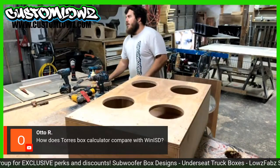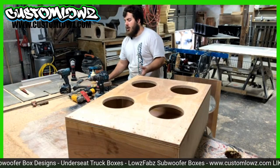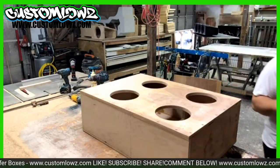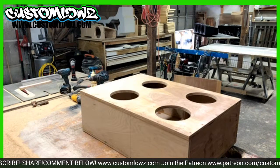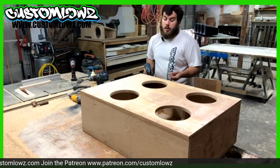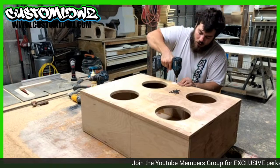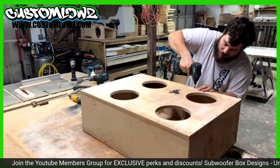So the difference really is that WinISD is going to be a more complex version. You probably get better, well, I don't even want to say better results. I don't use WinISD personally. I use Torres Box Tuner to get my basic box volume and tuning, and then I kind of go off different things I've learned throughout my experience of box building to come up with a good design. I don't think WinISD incorporates the vehicle or different cabin gains that different vehicles are going to have, which is, in my opinion, very important.